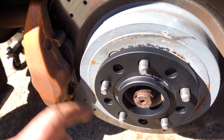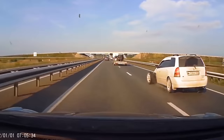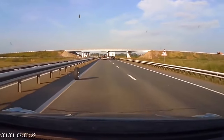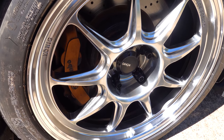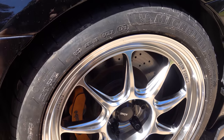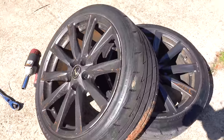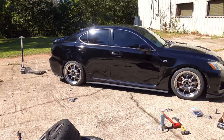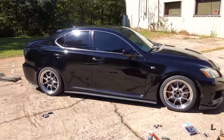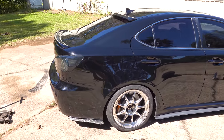Make sure you have the right wheel studs, otherwise your wheel may leave the car — and that is never a fun time. We are fully on the ground and set. ISF people, I'll put the part number for these Konigs in the description if you want your own set of 18-inch squares. We're now running 265s squared all the way around, where before we ran 255s in the rear and 225s in the front — substantially more rubber that doesn't look crackly.